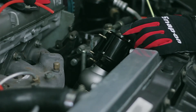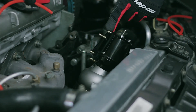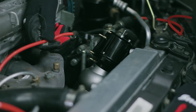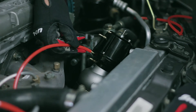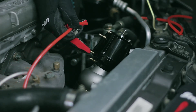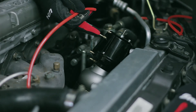The Synchronic wastegate has four different ports. From top to bottom you start with A, B, C, and port D. Imagine this is your boost source. On a traditional wastegate you'd apply it to one port and, depending on the spring, make a set amount of boost — let's call it 10 pounds. On the Synchronic wastegate, ports C and D open the wastegate, while ports A and B keep it closed.